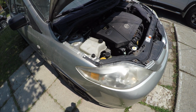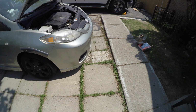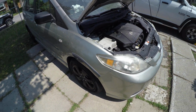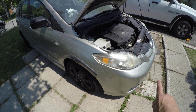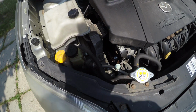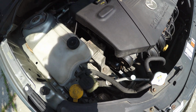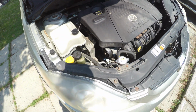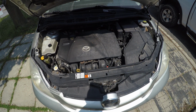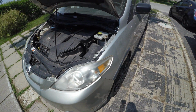However, this belt was ridiculously difficult to put on, even for a stretch belt. And I noticed on the box, I can't show you now, I threw it out in the garbage already, but the part number was scratched out, and it was rewritten with a magic marker. So I bet you it's the same length as it's supposed to be, but it is not a stretch belt. So if this thing does fall apart in the future, it might be overstretched. Right now it's very tight. However, it's still not too tight, so I'm hoping it'll last. If it's the wrong part number, oh well. It was like $5, $6 at the parts store, which is not a big deal. So AC is blowing cold now, and that part is okay. My father-in-law will be happy with it.